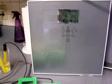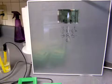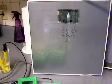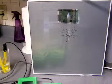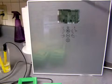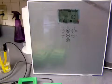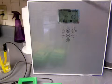I have 140 parts per million of hardness here in St. Louis, and I usually get great results. That's hard water, but it's not excessive. And I've heard of many people getting great results with the KYK around the country. I guess it doesn't function in hard water. So if you do have hard water and you don't use a reverse osmosis remineralizer or something to reduce your hardness significantly, you might not get as good of results as you're looking for.